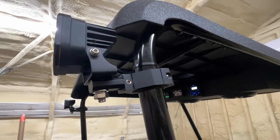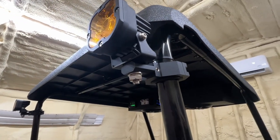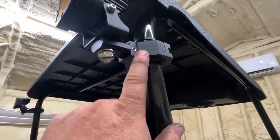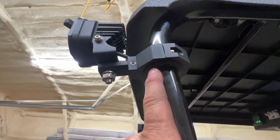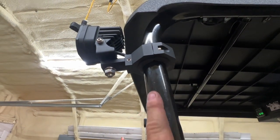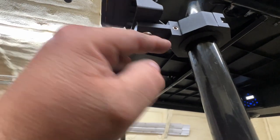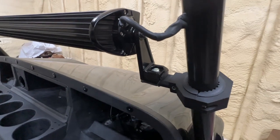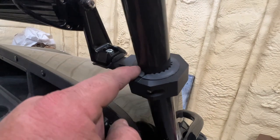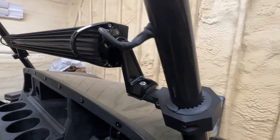Not included with the kit were these roll bar mounts that I used to mount the pods. The bars are one and a half inch, so I found a company on Amazon that sold these — I'll place a link in the description. It comes with different size rubbers to go between the bars, fitting one, one and a quarter, one and a half, one and three quarter, and maybe two inch. There's a longer and shorter outpost option. The outpost rotates and has a lock screw. To install, put the rubber between the bar, clamp it with two bolts, and bolt your brackets on top.